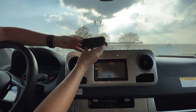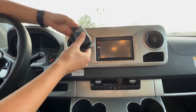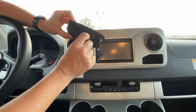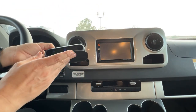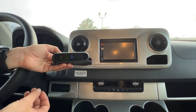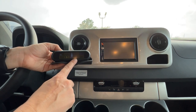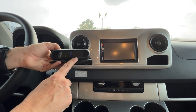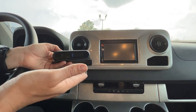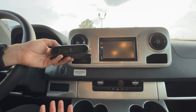Right here we have our tire monitors. This is what's connected to those six tires. There is a mute button in the back — that's the set button, and that's going to silence them if the alarm starts going off. Sometimes the alarm can go off when the pressures are showing a little bit higher. It's a hot day today, so they're going to be a little bit warmer than normal. That's okay if they go up just a smidge, but if they start raising too high, you do want to pull over and let some air out.